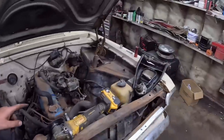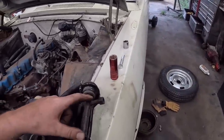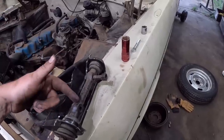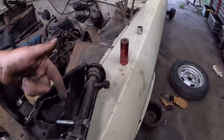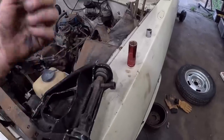I struggled. I couldn't get the one. So these bolts are splined in here. And they're 7/16 fine thread. All, for the most part, suspension stuff is that. I struggled. I couldn't do it. I had some just 7/16 hardware. This is a longer bolt than I need, but I just put one of those in there. It's fine. It'll hold it for now. And if I want to put like grade 8 fine stuff in.